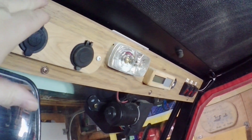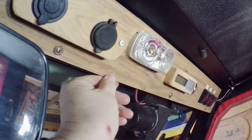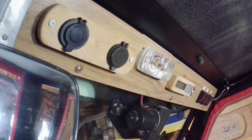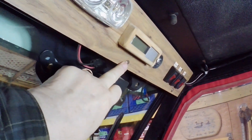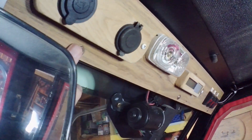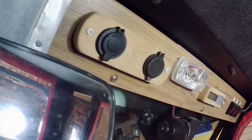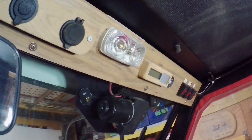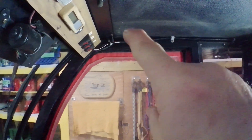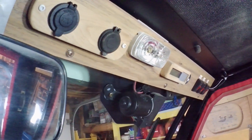What I did was this piece right here is just a piece of laminate flooring — 10 mil thick laminate flooring. It had a nice wood grain on it and I thought that'll fit. I got some spring clips that you can thread bolts into. There were four holes in the cross member, so I put those spring clips in with some stainless steel screws and secured the headliner in place. All the wiring comes in behind the headliner and I managed to fit it in there pretty good.